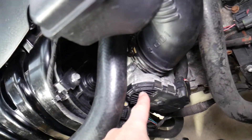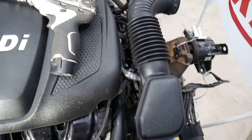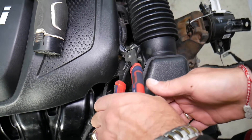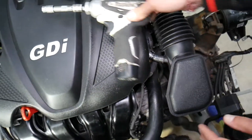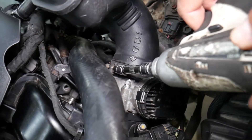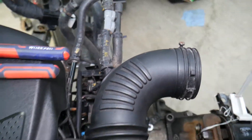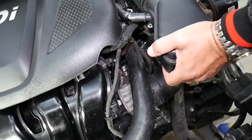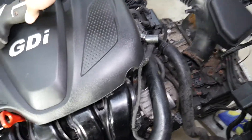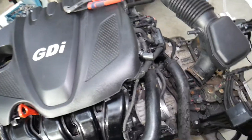Here's your throttle body. Kia Sorento and Sportage use different intake hoses, but you'll need to disconnect that hose. There are a few vacuum lines, and one clamp you can remove — just pull it. There's a hose clamp here with a 10mm that you need to loosen, the same as on the air filter box which we've already removed. Wiggle and pull it out of the air filter box, pull the other hose, and set it to the side.